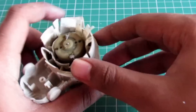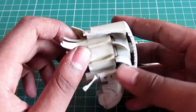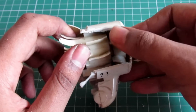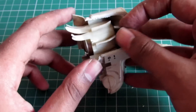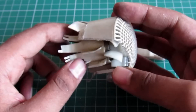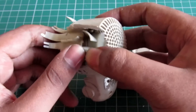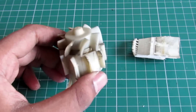To get the motor, I have to cut this whole thing with a hacksaw. Here is the propeller — it's somehow jammed, and that was the reason the hair dryer stopped working. The motor can still work after some mechanical repair, which we will be doing later. So right now let's take this thing out — and here is the propeller.